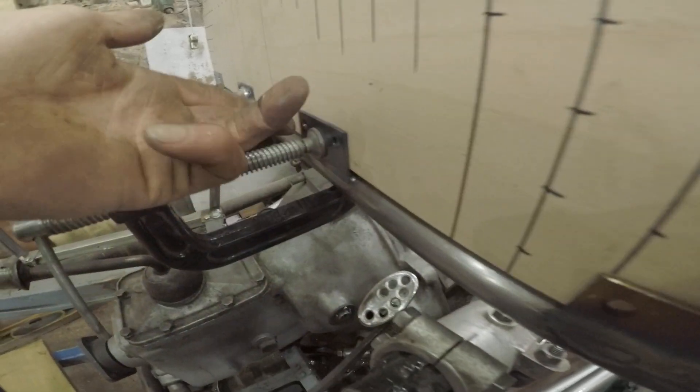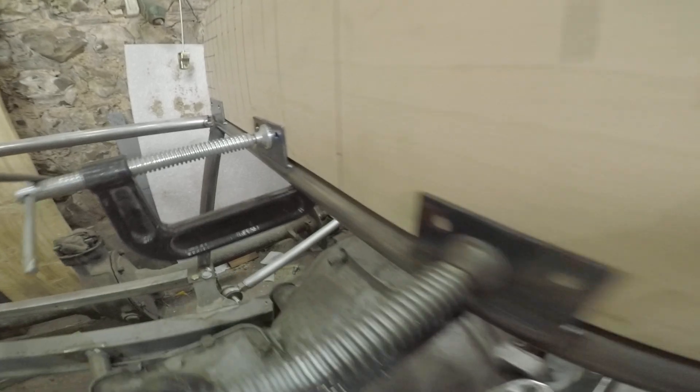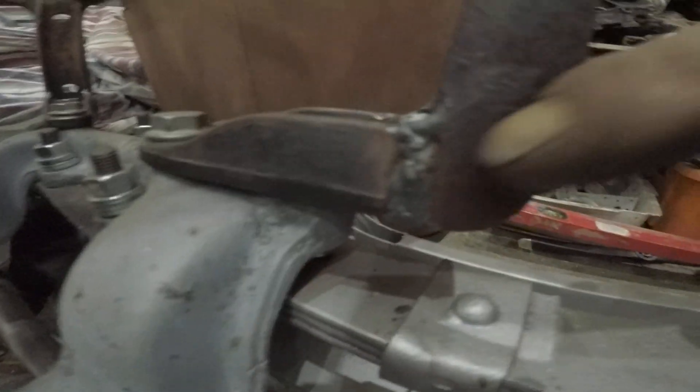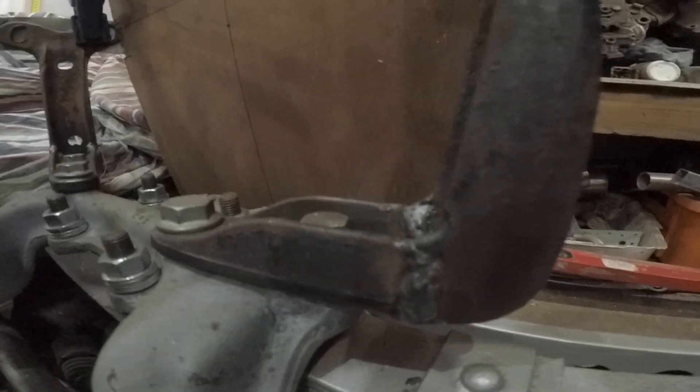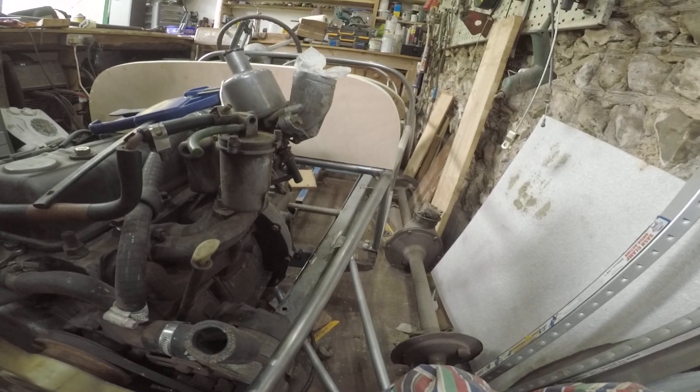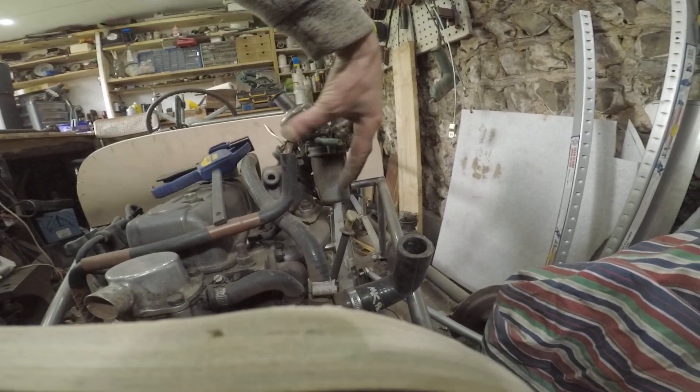I've got some little brackets along here so I can bolt the front bolt-head through that — just G-clamped at the moment. On the front, these bolts come down to the cow horns. With these front mounting brackets I've cut and welded them, taking about an inch off them just to bring these in and make the front a little bit narrower — same again on the other side. The SU carb sticks up quite high, so I'm going to lower that down.